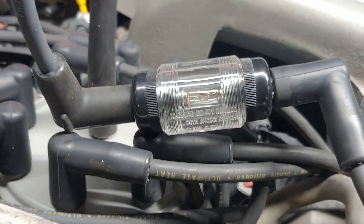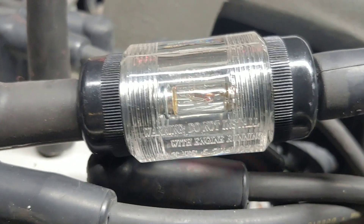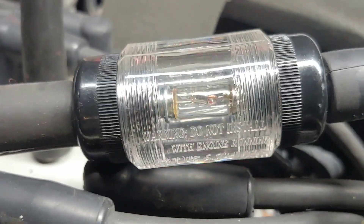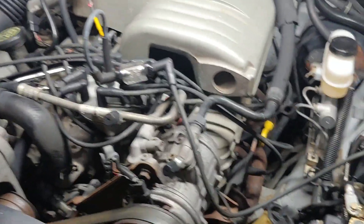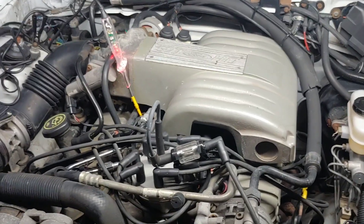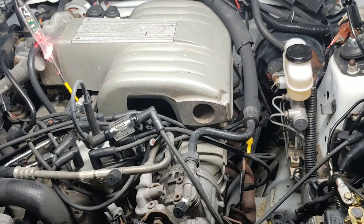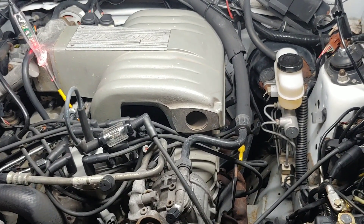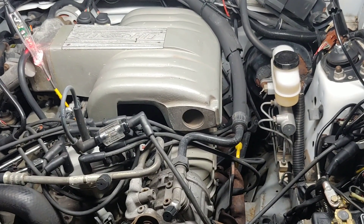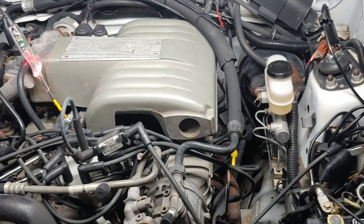Let's try that. Okay, that's a little more clear. So as you can see, rapid spark pulses when you're testing the coil, occasional spark pulses when you're testing a plug wire on one individual cylinder. Bear that in mind — depending on where you put the tester, it's going to have a slightly different result.